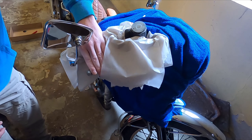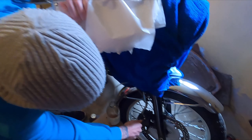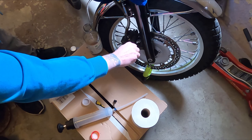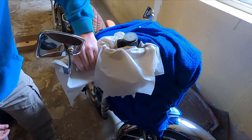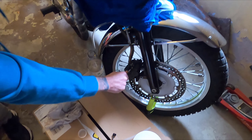So it's best to put the cap back on. Then pump the brakes, hold it in, and open the bleeder valve to get the fluid to flow out. Close the valve again and release the brake, then pump, hold it, and open the bleeder valve again.